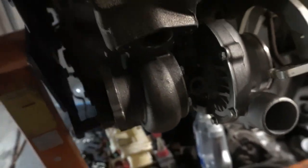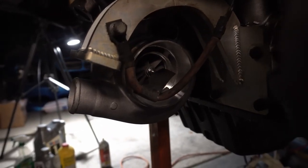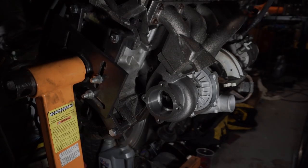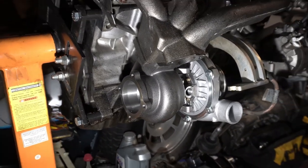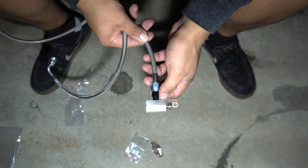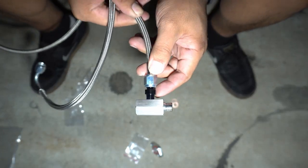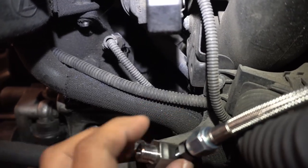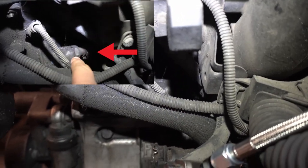It's clocked but I think I need some fine tuning. Just to give you guys an idea of how it sits — that's how much clearance there is. I want to run my intercooler piping right under the exhaust manifold and then figure it out from there. Moving on — this is pretty much going to attach to the oil sender area. I think I should be using some Teflon on this fitting but I'm just mocking it up right now. The area I'm trying to feed off of is somewhere right about there — there's a bung right in that area.